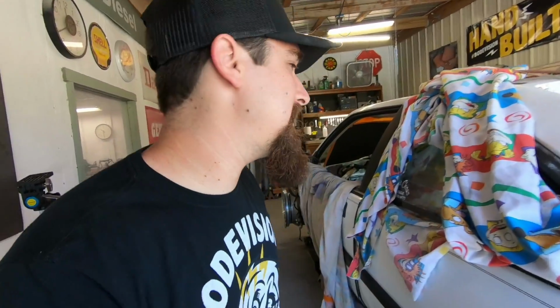So now actually the other side of that coin is I can put the steering rack in there, I can put the steering column in there, and then I don't have to touch anything. I could just slide that U-joint up the column and then plop it right down on the rack, and it is good to go, as opposed to struggling to place the column up to where it fits on that U-joint and then bolting it in. That was just a horrible design on the GTO, and I didn't want to deal with that on my current build. I just wanted to make it better, and I think I definitely did just that.